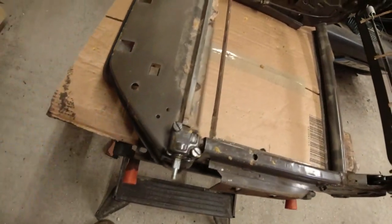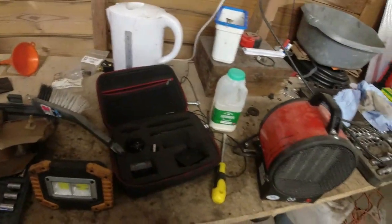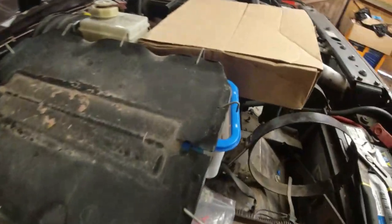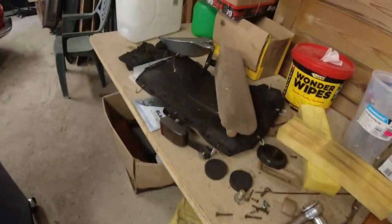So really, I had to take the diaphragm out because otherwise the diaphragm is just going to distort what I've got. But I'm going to replace the diaphragm anyway because it has disappeared. It has been taken. Here it is. You can see it started to tear. So it started to tear there and there, and if it starts to tear there and here, then it's not long for the world. So I might as well put the other diaphragm in. That one, because I know that one's good.